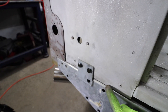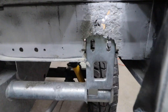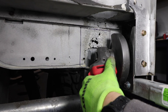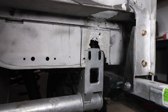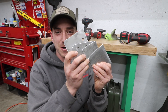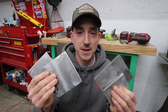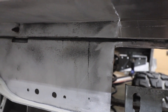After this guy's painted and before final assembly, we will have gaskets in between the steel and aluminum parts to keep it from corroding again. That sucked the tub back into place nicely. We went ahead and made up our patch panels — these will plug each hole that we cut in the Defender. Got all the bad corroded areas out and we'll have this fresh clean aluminum in there. We busted the TIG back out, got a pretty decent fit-up in there — we got it flanged on the bottom to match the OE panel.